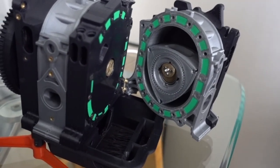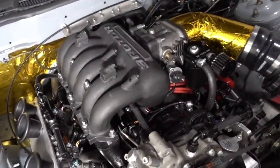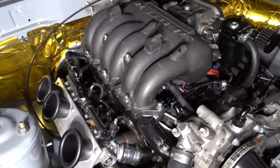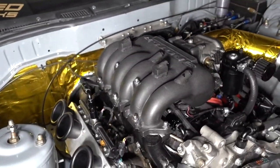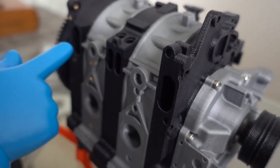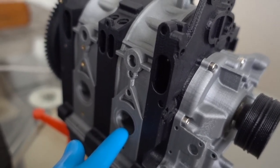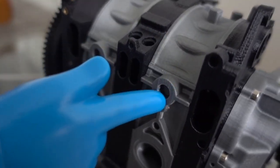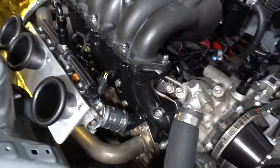The peripheral ports actually work on their own — they're not connected to the side ports at all. On this motor, I'm actually using both. The factory ports, which are fed by that air filter and the main throttle body, go into the factory side plates through the side ports. And then there's an extra port that goes right through the periphery of the rotor housing, which makes that a peripheral port.